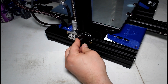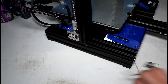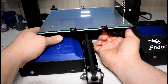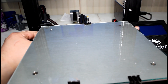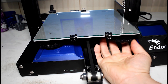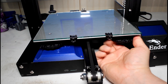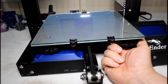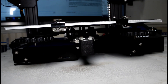You can actually loosen it enough so it will lower below that rail, or if you want to you can remove it. The next step is to go ahead and in pairs tighten all of the knobs — the front pair and then the rear pair — tighten them all the way up until they can't be turned anymore. Turning it towards the bed is loosening it; turning it away from the bed is tightening it. There are actually little arrows on the knobs.